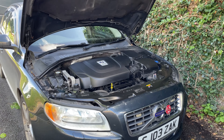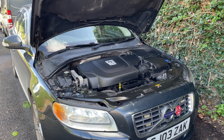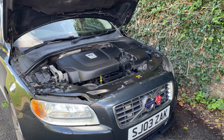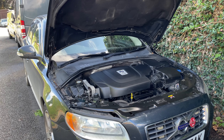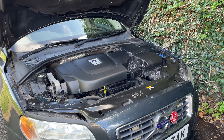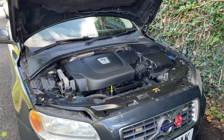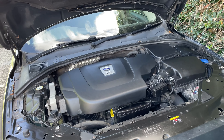Transmission fluid — this was last done at 79,000 miles on this car. So at 50,000 to 60,000 miles later it needs to be done again, which is coming up soon. Again, it's just to keep everything running cleanly, clear all the deposits out, and that's how you make these gearboxes last. They're very reliable as long as you're changing the fluid regularly.